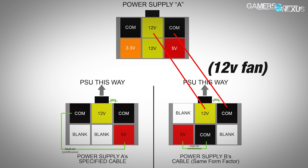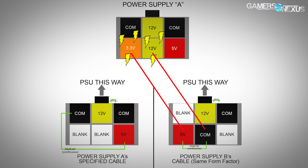The way I think about it, you've got three possibilities. First, you get really lucky and the different manufacturers' cables match up — it works fine. Second, cables are in the wrong spots, giving you incomplete circuits and no current flow — still pretty lucky, no damage necessarily. Third possibility: red is where yellow should be, yellow is where red should be, orange where black should be — reverse polarities, over-currents, over-voltages, all kinds of bad. It feeds back into other components. Protections in the power supply or component usually help, but they'll only protect you so much, and when mixing specs there's no guarantee anything works like it should.